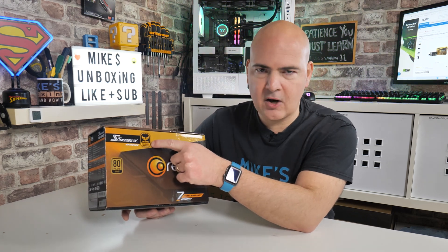So looking at the cabling - it is all black cabling, which is really nice if you're doing a build where it's going to be visible. No ketchup and mustard on show. You get a 24-pin connector which has the extra pin, so if you want to take that off you can to make it a 20-pin. This is the only cable which is actually braided as well as blacked out. You also have a dual graphics card output - PCI Express 6+2 or 8-pin. There are two of those which piggyback together. Realistically you probably don't want to be using both at the same time. The cables are split, which isn't ideal but you can still cable manage.